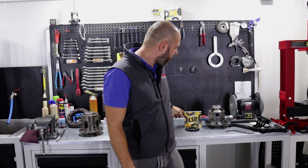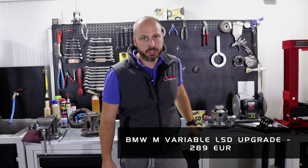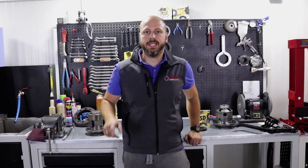Those are all the details regarding the installation of the new upgraded mechanical conversion for the E46 M3. If you like what you saw, this is available on our website — the direct link for purchase is in the description below. This can be mounted in all V1 units found in E46 M3 models up to 2005 production year. If you have a 2005-2006, E92 M3, M5 E60, M6, or Z4 M, you will need the V2 unit clutch pack.